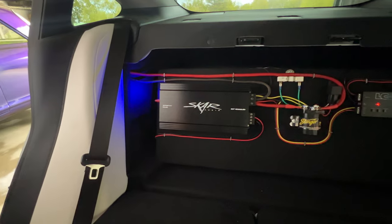I read somewhere that that 200 amp relay required like 0.3 amps to turn it on, and I couldn't find what the LC2i Pro output power is. What I ended up doing is running a smaller relay that the LC2i Pro goes into, activates the relay, then the high power from the relay activates the low power on the 200 amp relay. So it's a double relay system, but it works and is exactly what it's supposed to. It looks pretty good. I'm decently happy with it. The main thing is the car actually does exactly what it's supposed to do now.